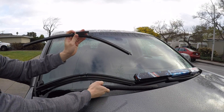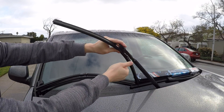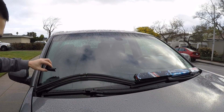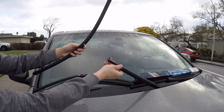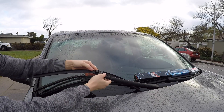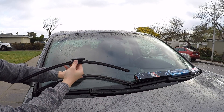This is actually a different length for the car but I'm using it for demonstration purposes. When I add it here you can see it fits fine, but when you set it down you have this big plastic piece that doesn't really belong, and the cover simply doesn't fit. When purchasing replacement wipers, definitely look at what the original ones look like — if you own a German car, most likely it uses a different style blade that a universal one simply won't fit correctly.